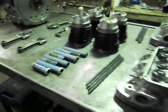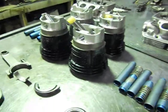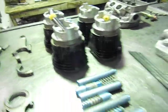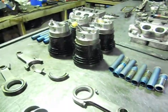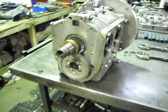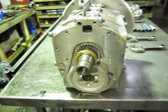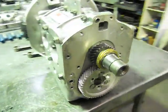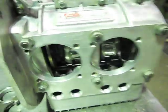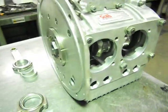If I had done what the customer asked and basically just done the cylinders — which we've got all prepped, machined, painted, and ready to install — we would have put all the barrels and heads back on it, thrown it in the race car, started it up, and this baby would have lasted all of about 30 seconds. We would have had spun bearings on everything: mains, big ends. It would have destroyed the block, the crankshaft, the connecting rods — it would have been game over.